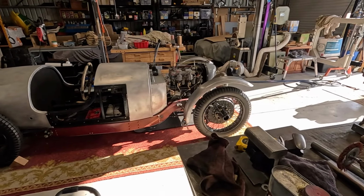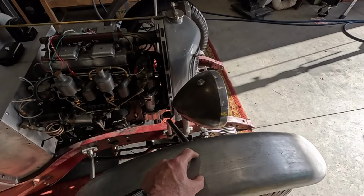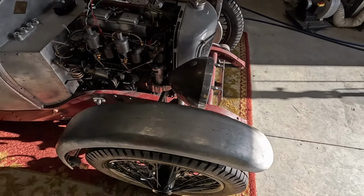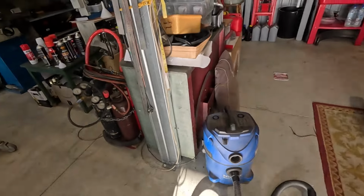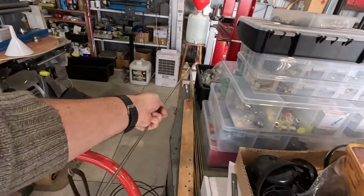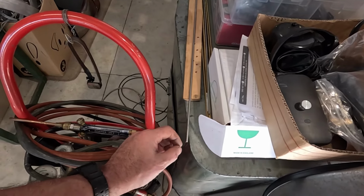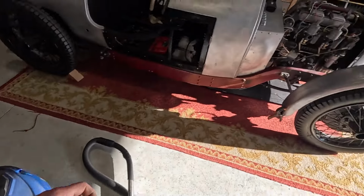Today is Sunday. My plan for today is drill the holes and get the bolts actually mounted for this, because then I can actually bolt these on, and bolting them on will make it easier to finish some of the hammering on this because it'll hold them. That's the plan anyway. And I'll also look at doing those diagonals. I figured for the brackets on the end, because my adjustment is down one end on the little turnbuckle there, to tension them, all I need on the other end is a flat tab welded on. I'll see if I can find some stainless steel, and I think I can bronze, like TIG bronze weld those together. I'm not sure. I've got some scraps. I'll do some tests. And then I just make a little metal tab on the end and just a bolt straight through.